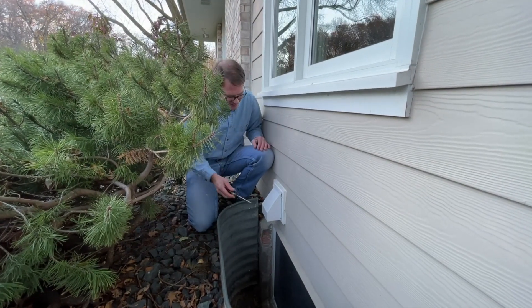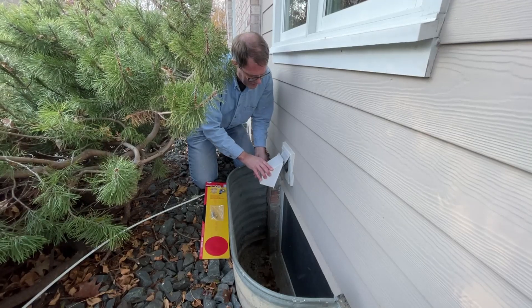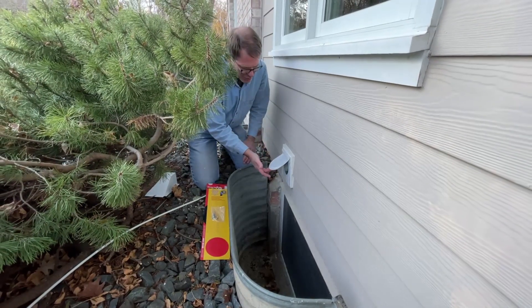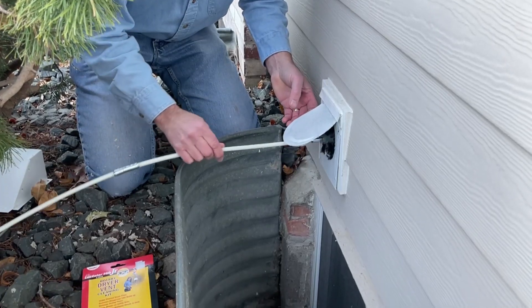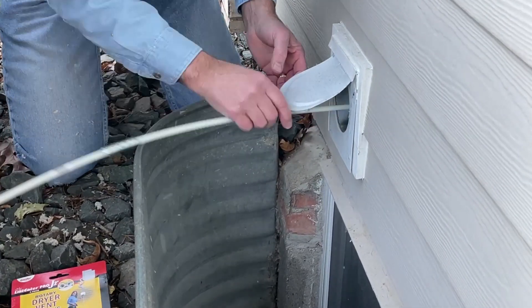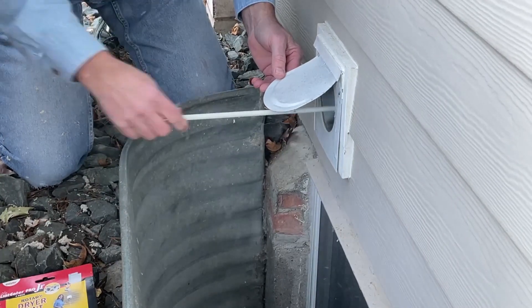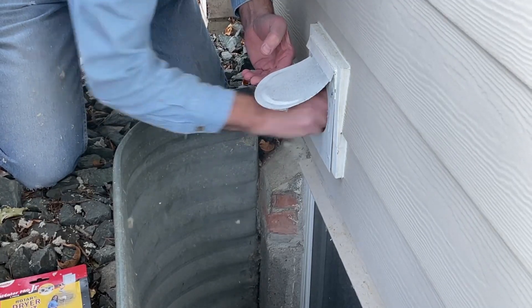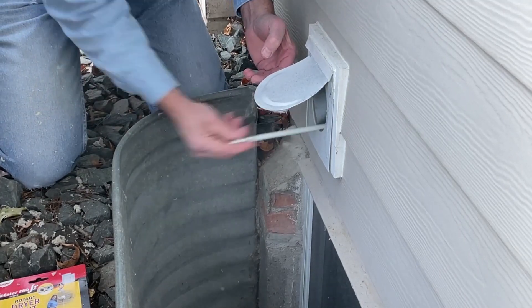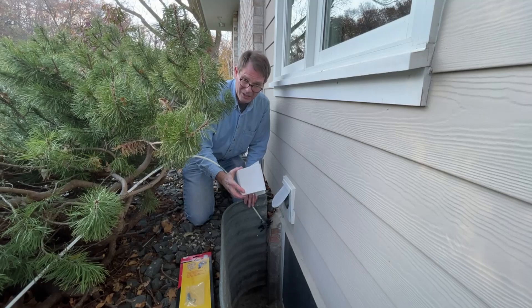Now it's reinstalled on the house and I've got two stainless steel screws — one here and one here — I'm going to take them out. I can simply tip this out and pull it down, which leaves this little flap here, but the little flap goes up pretty easily. Now I can take this dryer clean out kit — the LintEater Pro Junior which I purchased at Menards — and slide it into the vent very simply. I've got the dryer running, and you can see the lint I'm getting out of there. There you have it. I can reinstall the vent and in six months I'll come back and do it again. Thanks for watching.